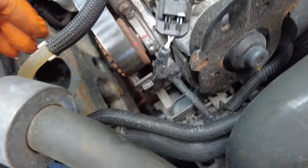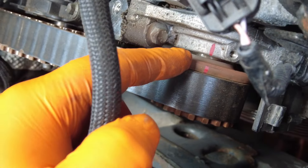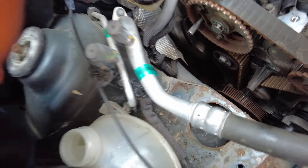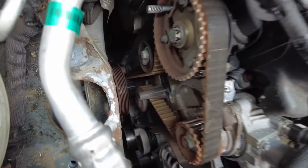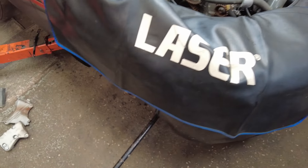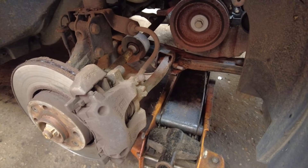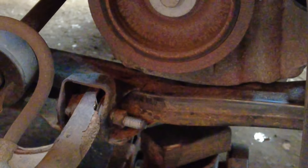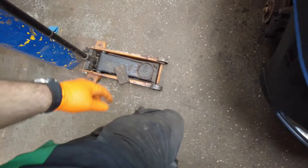Now everything is locked off. We've put our own little mark on the fuel pump there — a red line with a little bit of marker pen, just for reference. Now undo the three 8mms on the camshaft pulley because that is a free-floating pulley. We can take the car up now — if all goes to plan, we should be able to just let the engine down and it will rest on the subframe. So we take the vehicle up in the air and remove the jack.